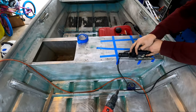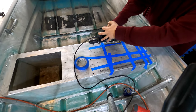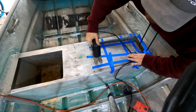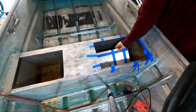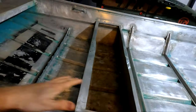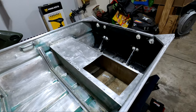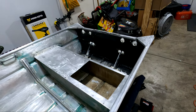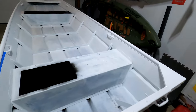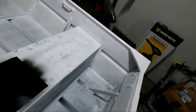Turns out the openings were not large enough to fit the gas tank, so I ended up cutting out the entire top of the bench, as you'll see in the next clip. This worked out much better for what I ended up doing with the area. In general, this method of marking out the cut lines, drilling out the corners, and using a jigsaw to cut the openings worked out really well. If I wasn't trying to fit a gas tank this would have worked out perfectly, but I decided to make things a little easier on myself and open it up completely. That's all I have for the bench hatches for now. In the next video I'll be finishing up the interior painting and moving on to flooring and bench lids.